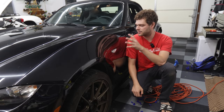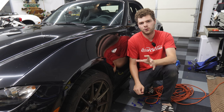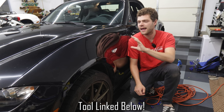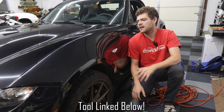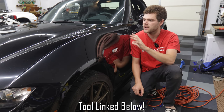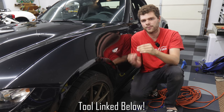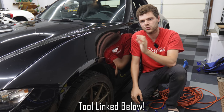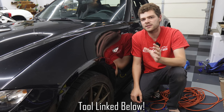With that I am done working on this fender. I would say this is about an 80% improvement — you can still see the dents and the surface is still a little bit ripply, but they're not big divots anymore, just a little bit of a ripple. I could spend more time going from the back and knocking down the high spots for the ones I over-pulled, but whenever metal dents — aluminum more so than steel — it stretches a little bit, so when you pop the dent back out you'll get some ripples unless you rework the metal, which does take a lot of time.